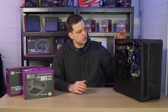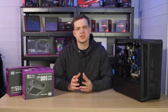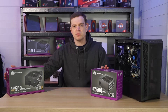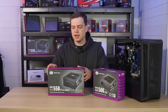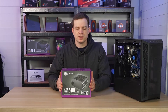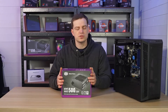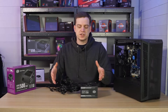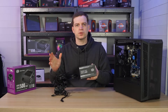As mentioned, this isn't just about installing a motherboard — we're also going to install a power supply and do some basic cable management. We're going to stick with the Cooler Master theme and look at a couple of different power supplies. Ideally for clean cable management you'd want a fully modular system where you decide which cables to use, but we're actually going to install a fully wired power supply instead, which means we'll have to do some work to manage the cables.